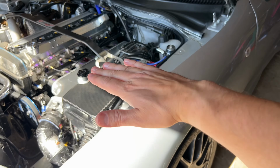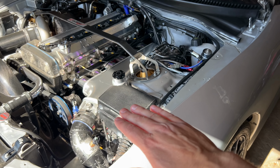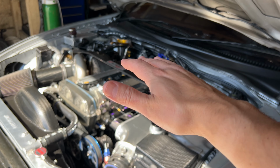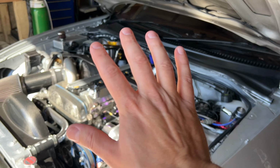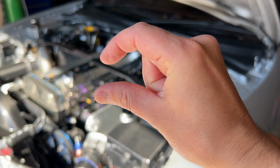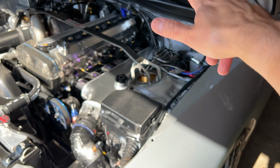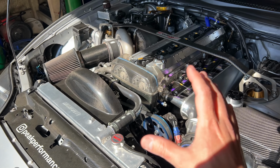So the feed and the filter sock is right down at the very bottom of the tank, because it keeps not liking it when I'm anywhere around a quarter, even a little bit over a quarter, under hard acceleration. It's probably only this much of an extension, or taking off that amount, which is enough really when you think about it, because the tank is quite flat. Anyway, I digress. Let's go on to some of the other things I'm quickly doing today.